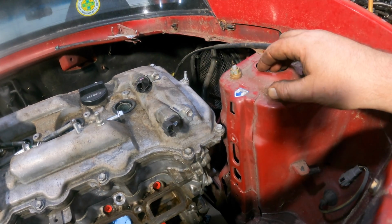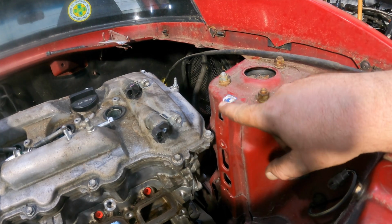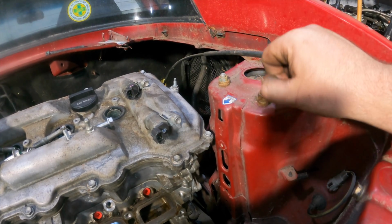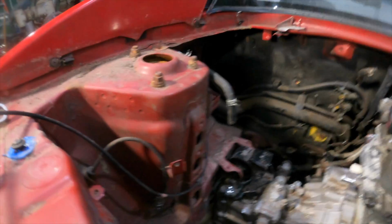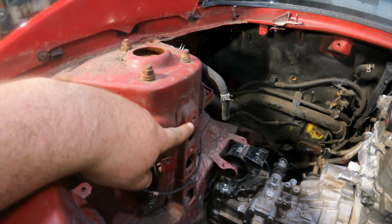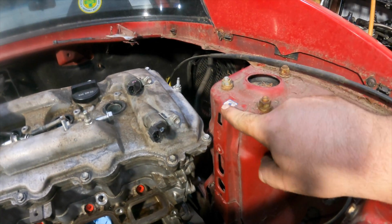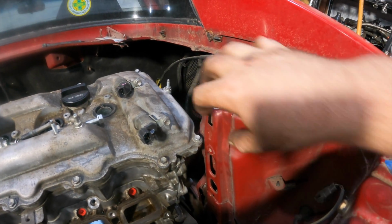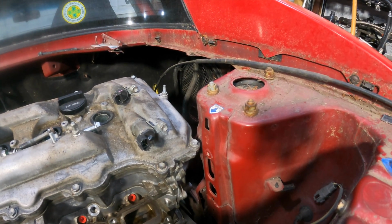it'll be just fine. Now keep in mind, this is just your prop rod support, and before you say that, you know, this is a strut reinforcement, I'm sure it's adding some strength reinforcement, but if you look at the other side, you can see that that one also ended where they had the last use for it, right, which is these bolts here. And this one, of course, ends where they have the last use for it. So this, I'm pretty confident, is just an addition that's there to add fastening points.